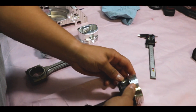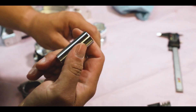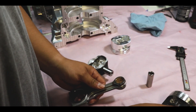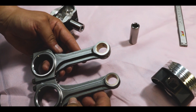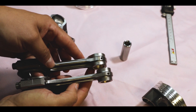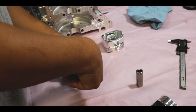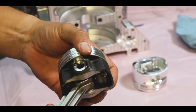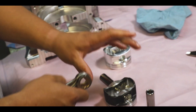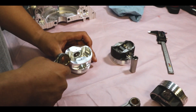We went from the little 18mm pin to a 20. Now we're getting a lot of strength and structure back into the piston, and we also redesigned the rod. When we're going up to make changes like this, let's just beef everything up — our structure here is huge, we made it wider everywhere. This is the piston that goes in our V3 engines — super super strong. We've been running this piston for a while but we've also switched over to a custom piston with a full round skirt for even more strength.